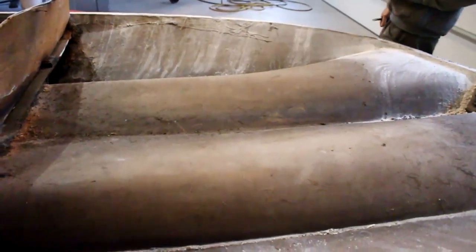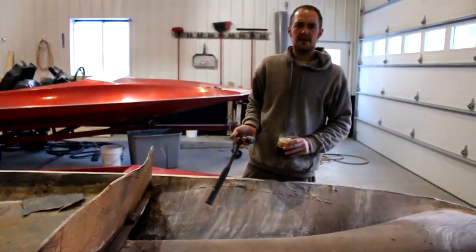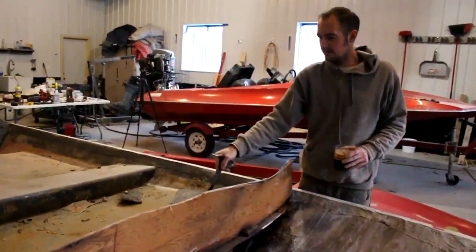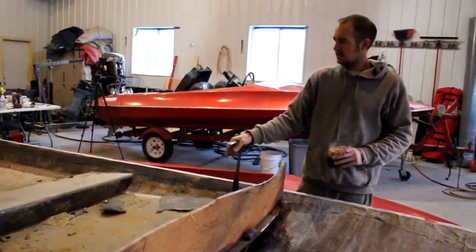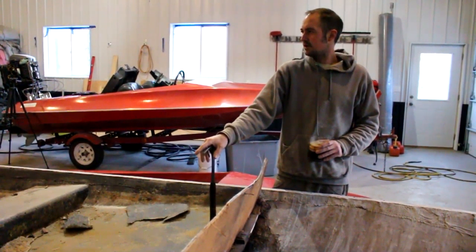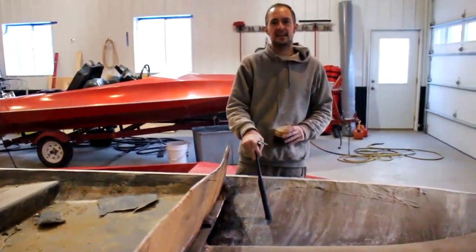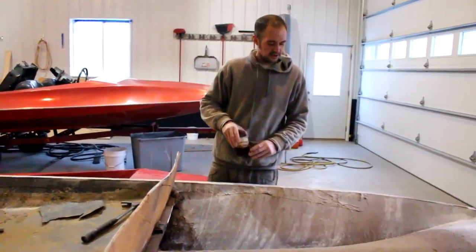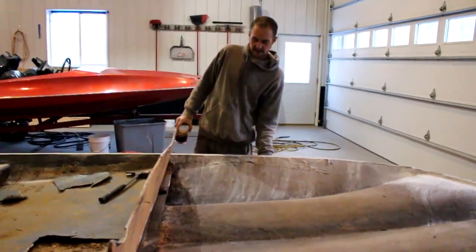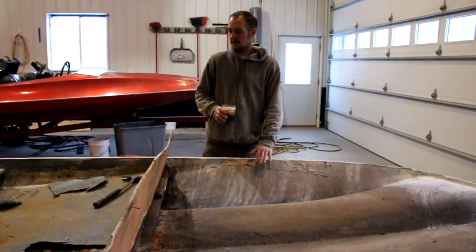There's just a little bit of a drainage issue. Quite a few fiberglass issues. A transom issue. And we're going to redo anything that's wood in here. So, I suppose the first thing is to do some ripping and get a grinder out, but before we get this tooth in, we're going to have to build a cradle. Something to really support this boat because, well, we're going to be down to nothing but a fiberglass shell that came off a mold in 1971, so we don't want to break that.